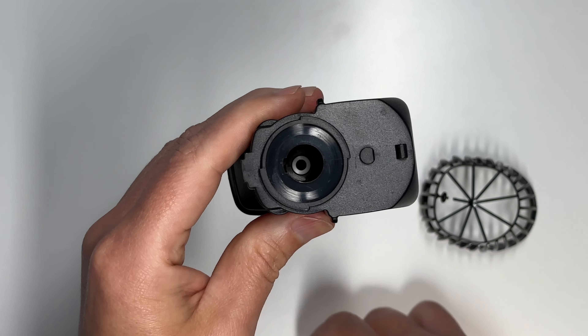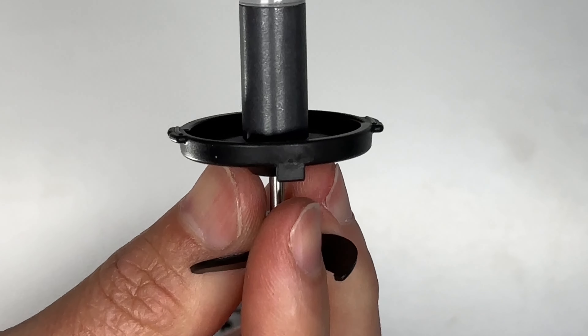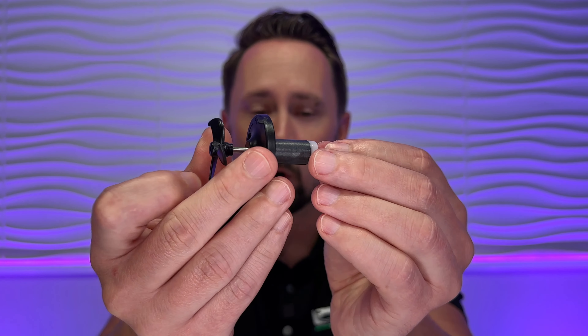Why would you do that? To clean. You're going to put this in pump clean or your favorite aquarium product cleaner. Now you're going to visually inspect the inside, making sure that there's no issues, debris, or things that could be impeding or hindering the rotation of this impeller. And then you're going to inspect this impeller — the magnet, the shaft, the blades — making sure everything is in proper working order. Then you can let this soak in pump clean, do a little brushing, look through it, and put it back together in reverse.